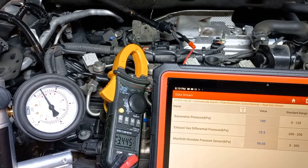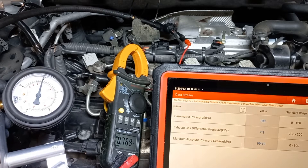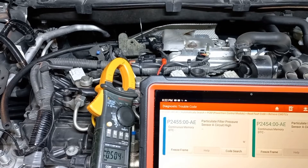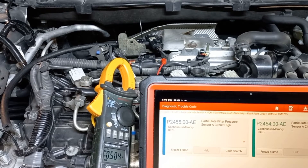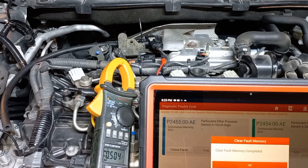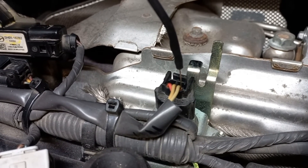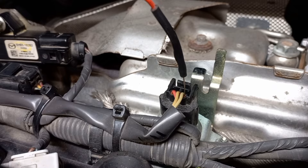Here I am experimenting by applying a vacuum to the pressure side. If faulty, it inhibits EGR control and idle stop operation, and the PCM restricts engine automatic transmission integration. Possible fault codes are P0472 and P0473. Symptoms include hard shifting and engine jerking.